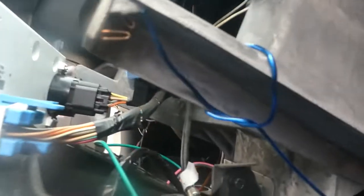The screw that goes up here is also 7mm, but after I slide that up, I'm able to pull this out, set it on the seat. Check this out, guys. I ran the remote wire. I lightly tied it there so it doesn't get pulled. And it's so easy. Look at this. This is the easiest set wire hiding I've ever done in any car, and it's this Pontiac.